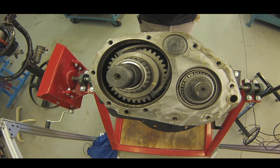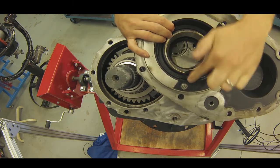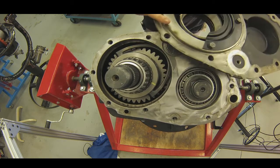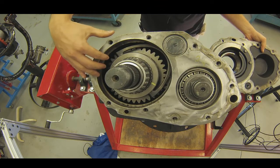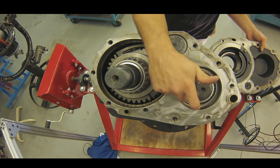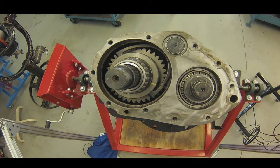What we can see right here is a little trough, and that trough is to catch any oil that's being slung up into the top of the housing. It catches it and directs it down onto the pinion bearing right there.